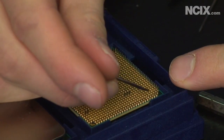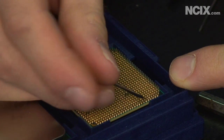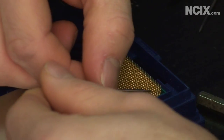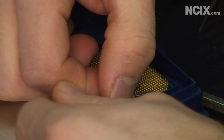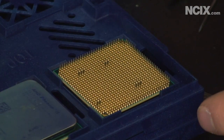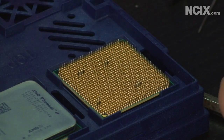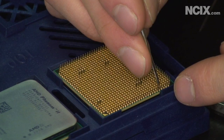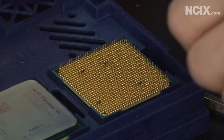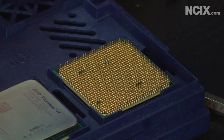You can see here we're trying to lift up the pin from the very base. You never want to move it too much at a time because then you can end up breaking it off. We're lucky this one didn't break off already, to be perfectly honest. We got it lifted up from the bottom, but the pin is still very bent. The best way of straightening that out is actually a graphite mechanical pencil — you can use the open end of the pencil to straighten the pin. But we don't have that, so we're going to try and use a couple of pins to do it.